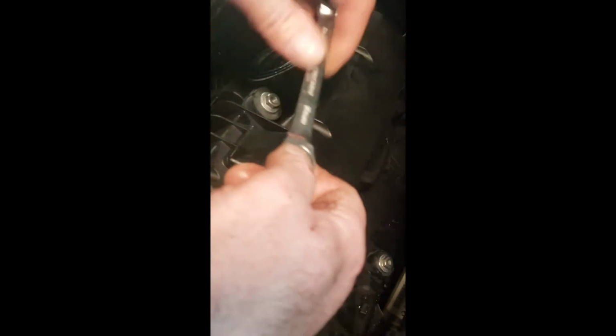Okay. Now remember, we said we couldn't get that one on the bottom and the back with a ratchet. So we're going to come in with a flat ratchet, again, number 10. And unfortunately, you're not going to be able to torque this. If you are, you're a better man than I, or woman. But we're just going to get it started, and when it comes time to torque it, we'll just have to guesstimate a little bit. Again, if you've been swinging a wrench your whole life, you'll have a pretty good idea of how tight to make it when you judge it by the other bolts. I don't want to say a number right now, but it's somewhere around 7 or 8 foot-pounds, I believe. We'll check the book in a little bit. Remember, everything in the Bentley book is typically Newton meters. You do a quick conversion on Google, and it'll put you right around 7.5 or 8.